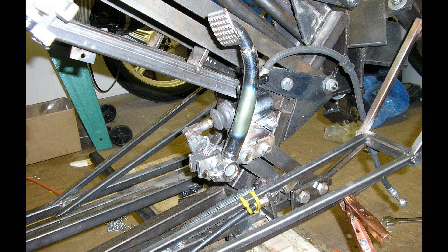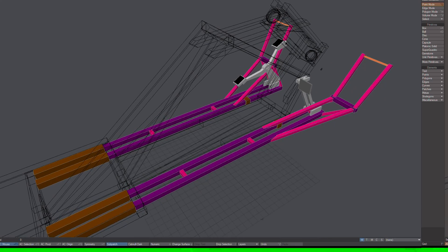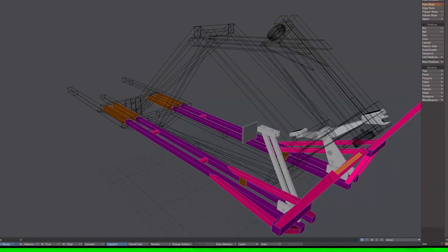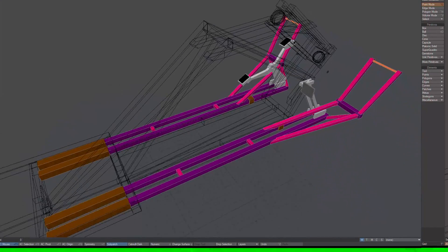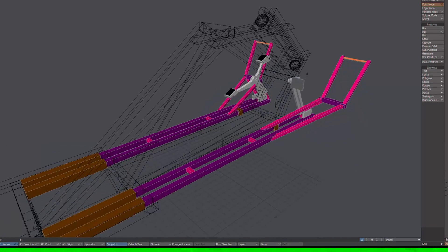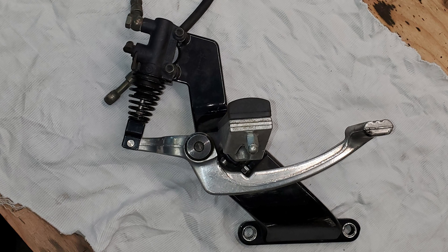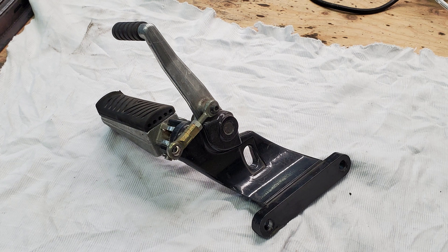Next up would be some major updates to the foot controls and foot rests. My existing foot controls were hand fabricated and quite heavy. The existing foot controls and foot board assembly was also based on two parallel three-quarter inch square tubes, which I didn't feel had the stiffness and strength to resist forces involved with something like sudden braking. So I had these aftermarket foot controls which were much lighter and looked like they'd work really well, so I thought I'd upgrade to these.